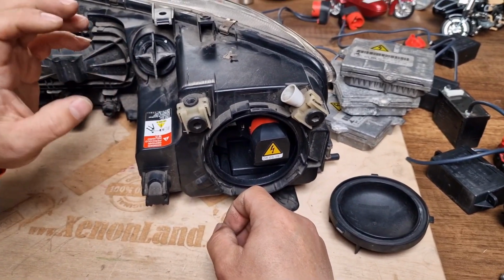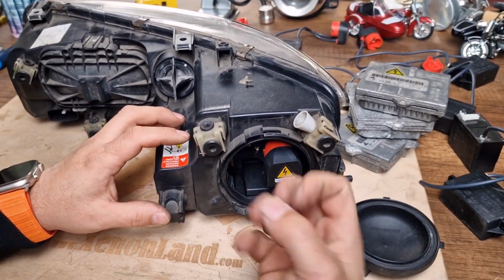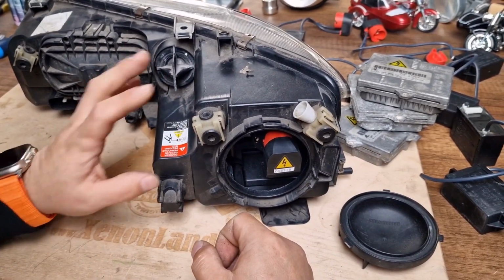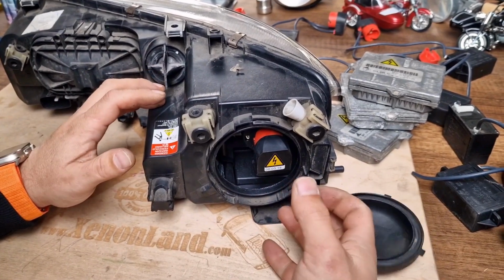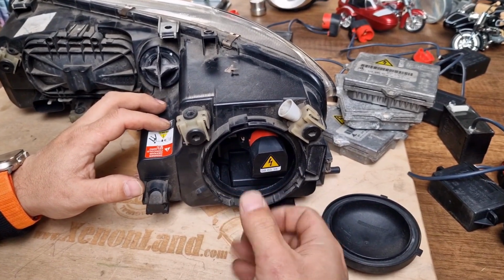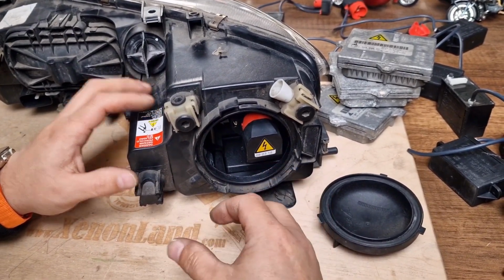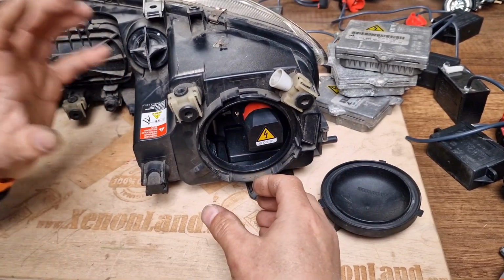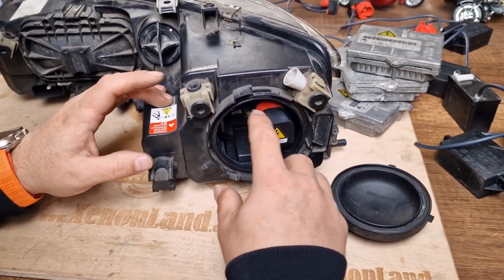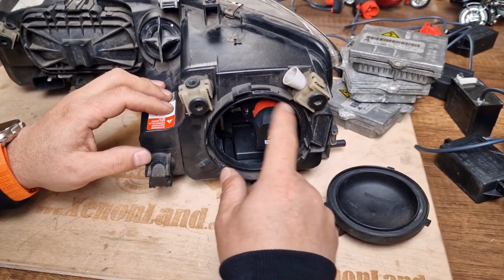If you look at the other Mazda 6 videos on YouTube, you will see that there is almost no access behind the headlight. Some are trying to change the halogen type bulbs, high beam and low beam bulbs, using the access under the fender, under the wheel arch, by removing the fender. But for the Xenon type headlights, it's very difficult. Still, if you know what you are doing, you can try it. But please bear in mind that you are risking breaking the expensive Xenon bulb connector or the igniter socket, the legs of the igniter sockets.